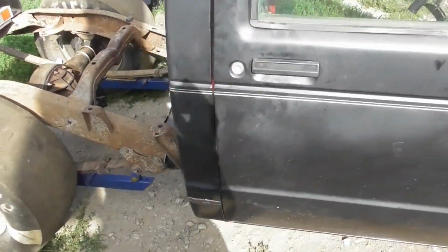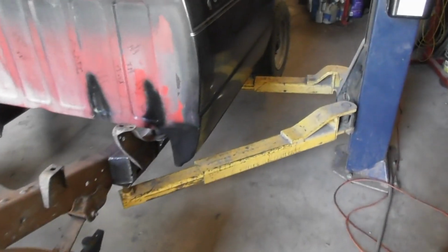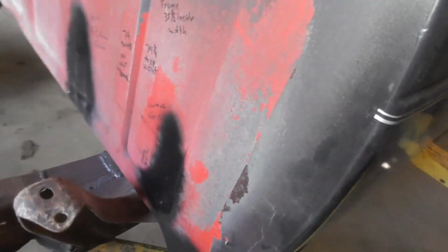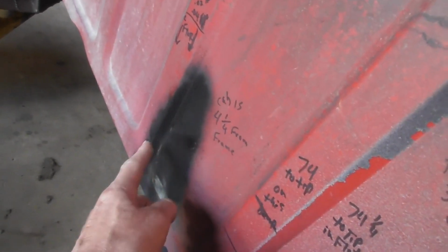You don't have a whole lot of grinding to do on this side, mostly on the driver's side. Well, I got the grinding done from the cab corners and all that stuff. I didn't show that because I'm pretty sure nobody wants to watch somebody grind on welds. I didn't even want to grind on the welds. Anyways, I had to cut that jack mount out of there and end up with some holes in the cab. Weld those shut and ground them down too.